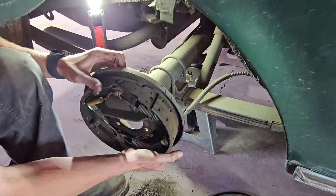When installing this kit, it comes with new brackets for the axle flange. We'll have to cut off the old bracket and install the new bracket to mount the disc brakes. Right now I'm greasing up the splines and also putting some on the seal so we can prevent any tearing when we throw these axles in. Now we're going to slide the axle in — be careful on that seal. We don't want it to rest on the seal itself, just to prevent bending the seal. We're doing this very carefully so we don't mess up those splines.